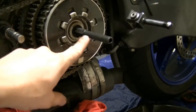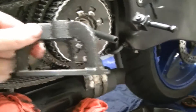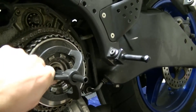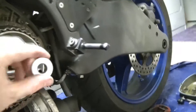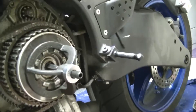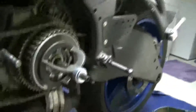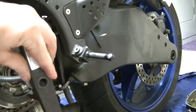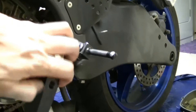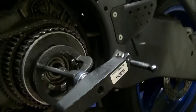That's the part I was worried about. You have to thread it on, then put this little dish piece on like that, then put the bearing on — I assume it goes this way — then the washer, and finally the little handle piece. We put this on like this and tighten it down until the spring is compressed, then snap in a snap ring.